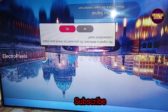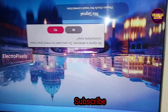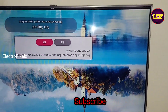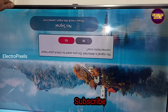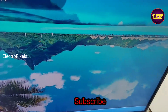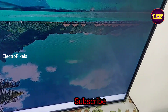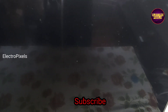Hi friends, this is a 43-inch LG 4K Smart TV. The complaint in this TV is a picture freezing issue, and you can see vertical lines and horizontal lines appearing on the TV screen. As discussed earlier, these types of complaints are mainly due to internal shorting in gate signals inside the glass panel, if the shorting is from the left side or right side of the glass panel.